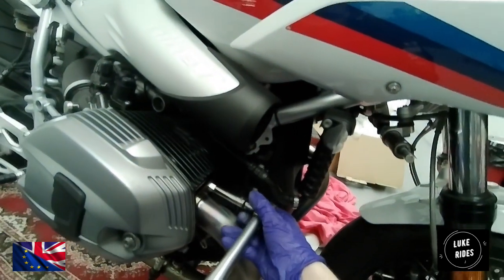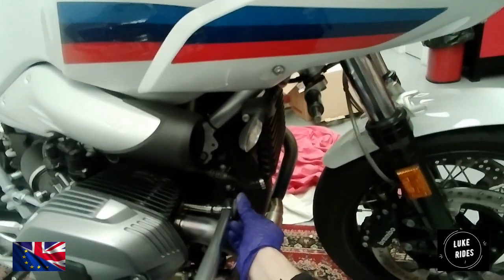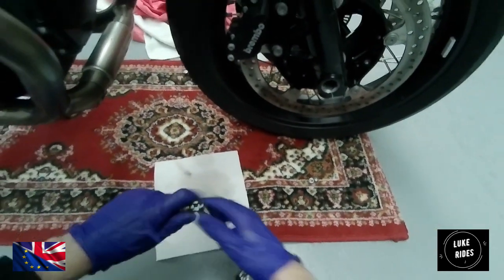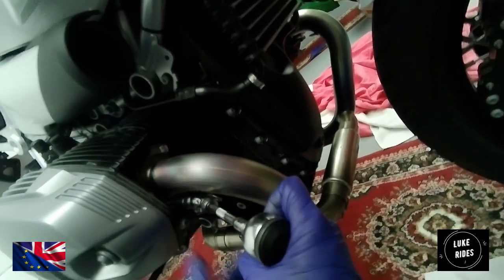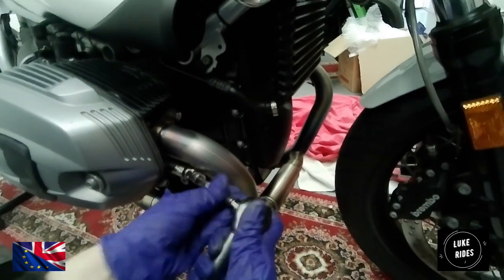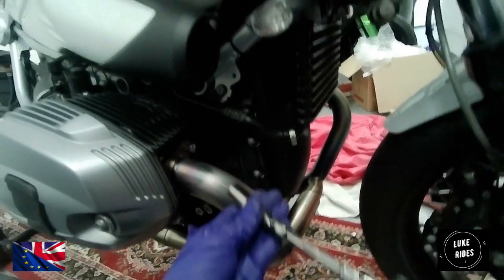That's a good point. What you can do is, because you have an exhaust gasket that is designed to crush down as you torque down the sleeves, you apply the torque evenly. What that actually means is, take the first nut, tighten it down, give it a few rotations with the ratchet, then take the socket off the top flange nut, go to the bottom flange nut, and do the same with that one. Just a few rotations, as best you can in that tight space, then go back to the top.